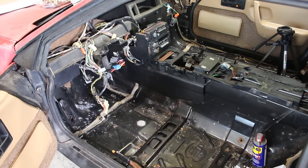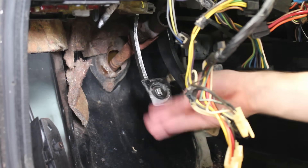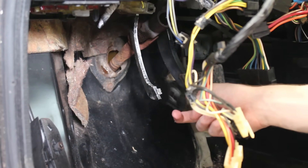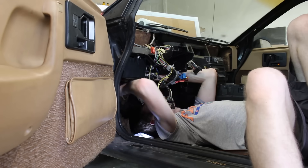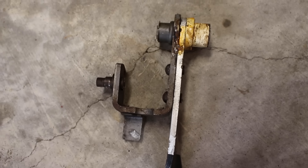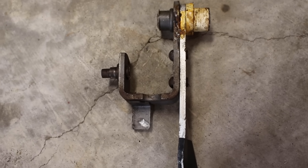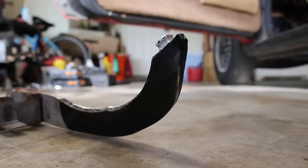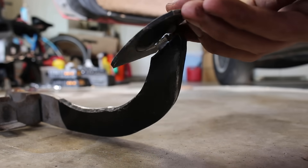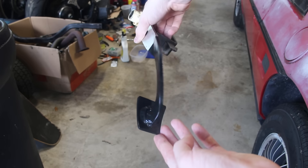The second mechanical repair is the clutch pedal. The surface you press isn't there at all — it just snapped right off, and the pad was actually found in the door panel pocket when I got the car. After struggling on my back for about 30 minutes, I got the clutch pedal out. The original U-shaped bracket was made of aluminum and bent really easily, but mine is steel, so either the car got the recall done or was made after it. Either way, the arm of the pedal is still aluminum and the pad still fell off. I brought it to a local machine shop and got it TIG welded back in place, and after a fresh coat of paint the whole thing looks brand new.